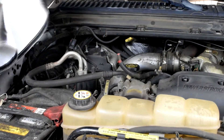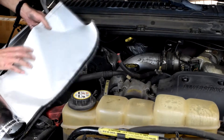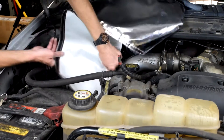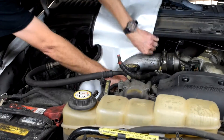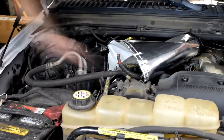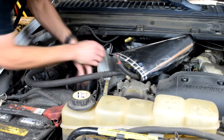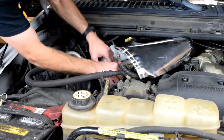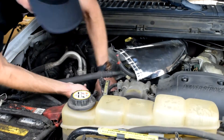Next we have our Heat Shield Products Thermaflex sleeve and we are going to install it on this intercooler pipe. I am going to feed it down in there into the bottom where it meets the intercooler. We are shielding our intercooler pipe because aluminum is lightweight and strong, but it is also an excellent conductor of heat — it will cool off quickly but it heats up quickly. We are just making our intercooler cooler.